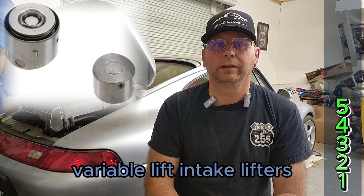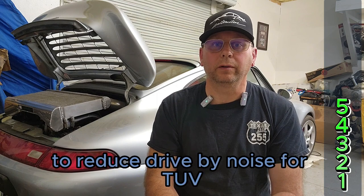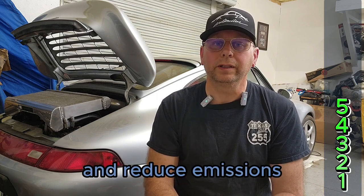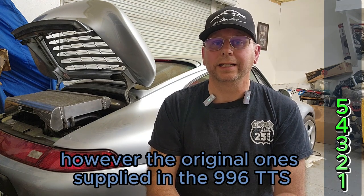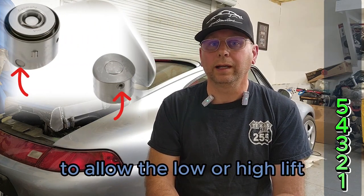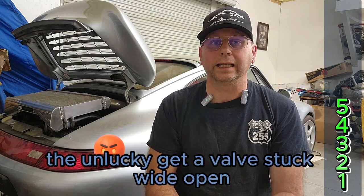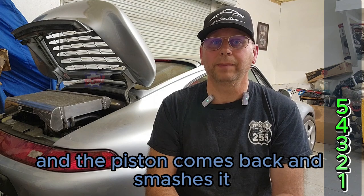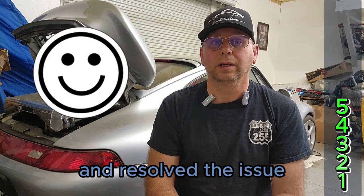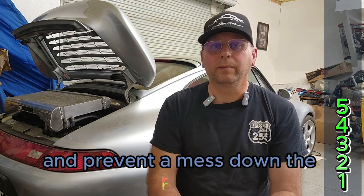Variable lift intake lifters. These are quite a marvel of technology, allowing a very small amount of valve lift at idle and light throttle to reduce drive-by noise for TUV, improve fuel economy, and reduce emissions. However, the original ones supplied in the 996 TTs have a problem: the tiny pins that slide back and forth to allow low or high lift tend to slide out a little too far, starting to gouge the cam housing. For some lucky owners it stops or merely machines a groove in the housing; the unlucky get a valve stuck wide open, the piston comes back and smashes it, and it all goes to hell from there. Porsche superseded these lifters and resolved the issue but didn't do a recall, so it's up to the individual to take care of this.